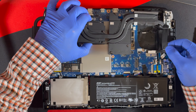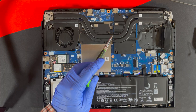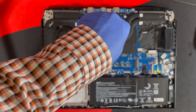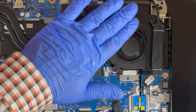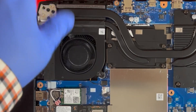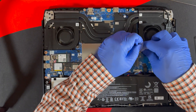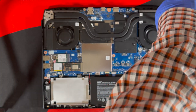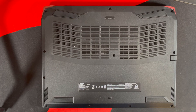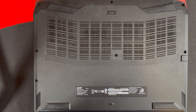When I replaced the heat sink, I mistakenly put the display cable on top of the pipe when it should have been under. Hopefully this won't be a problem later, such as a pinched wire. When replacing the screws, there are numbers on them which you can follow in order. Last to go in will be the fan. Reconnect both fans and return the screws. Lastly, reconnect the battery. Put the bottom panel on and return the screws. Alright, let's get this thing turned on — hopefully this wasn't all for naught — and let's hope we can see a temperature decrease, because everybody wants that, right?